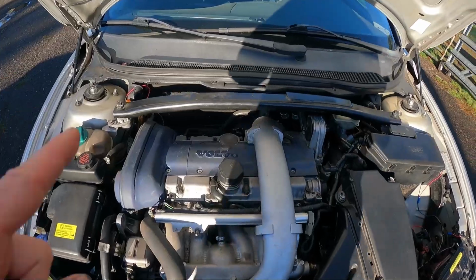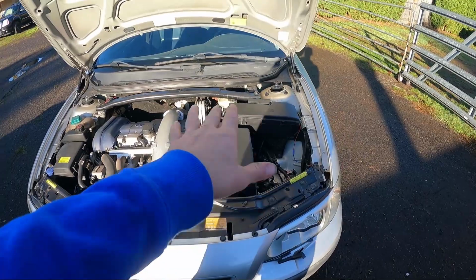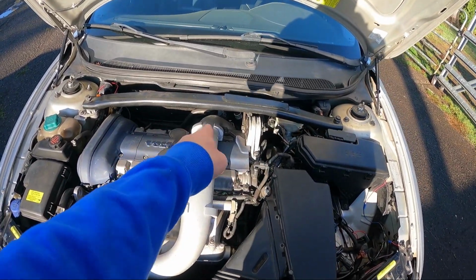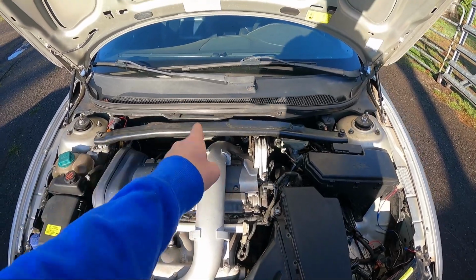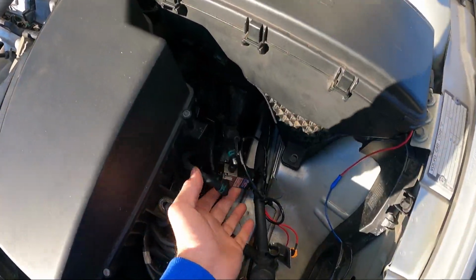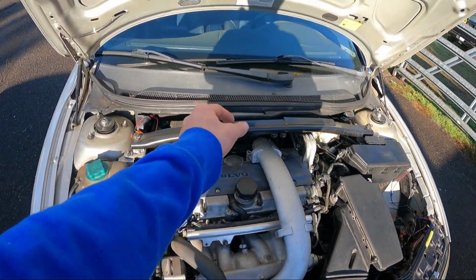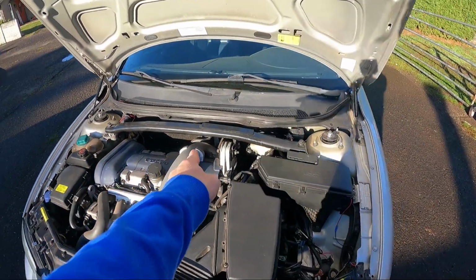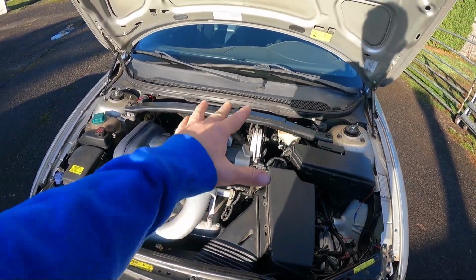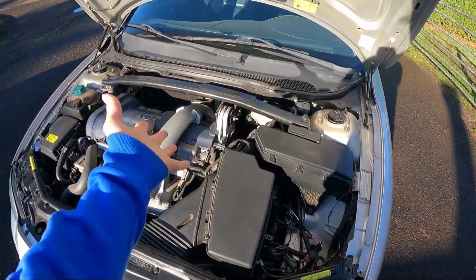So I went back to my wastegate and loosened it, because I think it wasn't letting off boost. It was constantly boosting when it's supposed to let off. So I had to loosen up the wastegate one turn. If you have a boost control issue and you swap this and you still have that code, it could be your wastegate. If you messed with your wastegate, that could be your issue. So make sure you don't tighten it too much. Loosen it up if you still have that issue, if you were swapping a turbo and adjusting the wastegate. So that may be helpful to one of you guys.